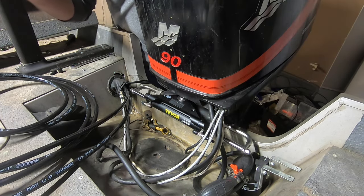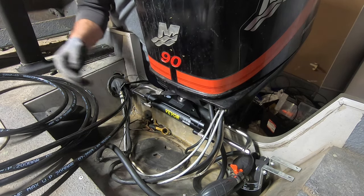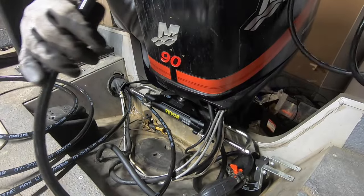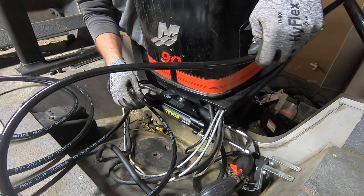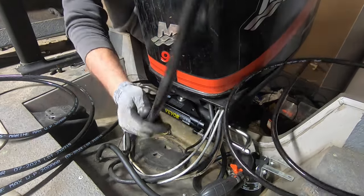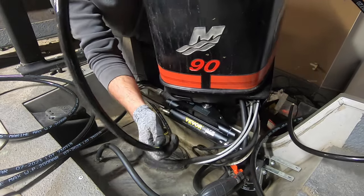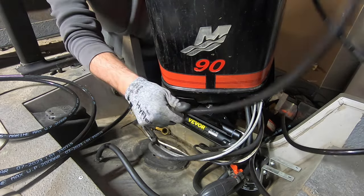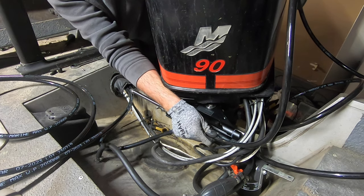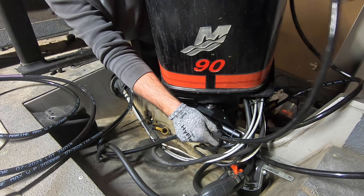So now remember, we had blue on the starboard up front. So we'll have blue on port in the back, which is this side. I'm going to take my blue line here that I've got way too much of, and cut it way extra long. I'm going to put my blue plug back in after I cut it, because right now it's hard to determine. I turn this all the way port, and this is my blue line. So I'm going to cut it pretty long, about right here, because I can always cut it again. But again, if you cut it too short, you're in trouble.